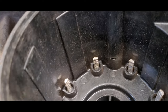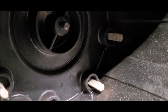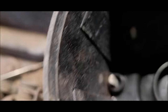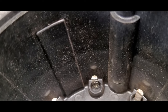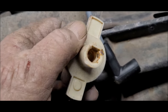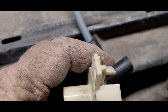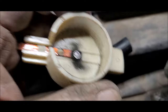I got all the plugs changed. Now I've got the cap off, and you can look inside there — those posts are pretty, pretty bad. It's kind of amazing that it was even running at all. But it did sit for 15 years, so it was pretty corroded. This rotor button was basically rusted onto the shaft of the distributor — I had to pry it off. It also looks pretty rough. So this is a good thing we're changing them out.